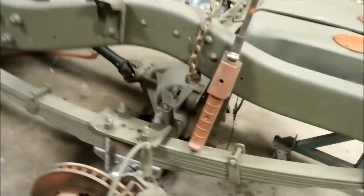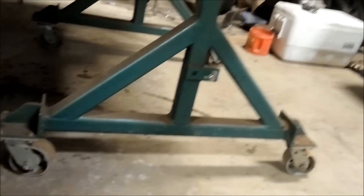We're going to set the bed on and weight this thing down. We got the bed on, axle in, sitting on the hub with a safety net — still got the big sawhorse under it. I've got a floor jack under the pinion right there and the little angle finder. We're going to set this up one more time and zero it.